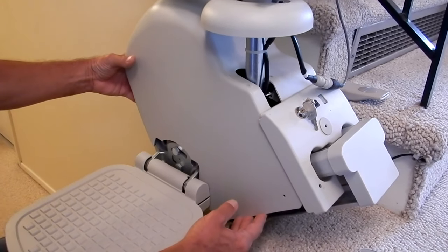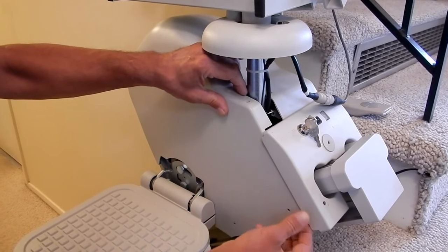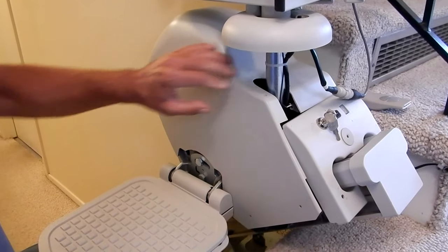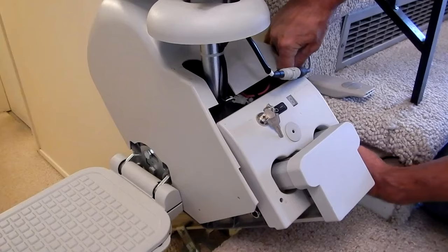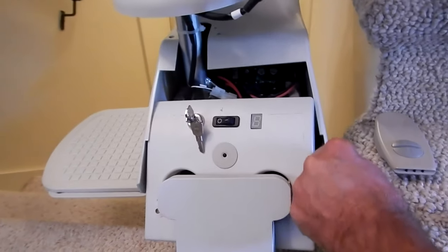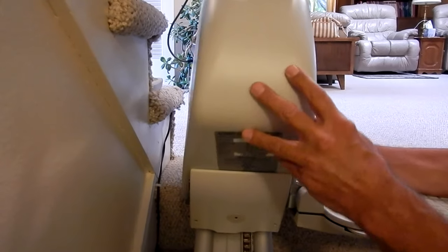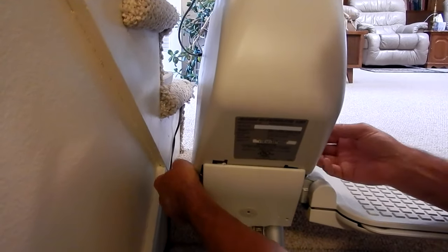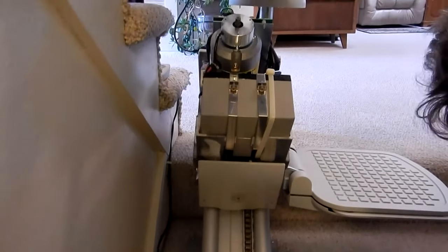Now you need to get this cover up - it's going to come up and off the back. What we need to do is lift it up slightly to get past this notch. You can flex the side of this enough to get around the upper limiter stop switch plate, then do the same thing on the other side. Lift it up so it's out of the slots, then torque it around that. Now the cover is loose from the switch plate - take it back a little bit and there it comes off. Easy as pie.